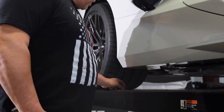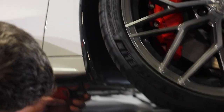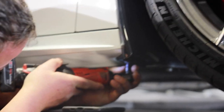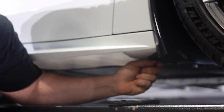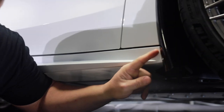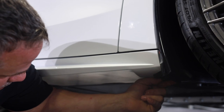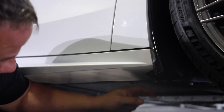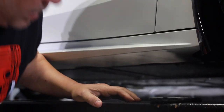As you can see, basically there are two 7mm screws in the back you're going to need to take out, and there's one 7mm screw in the front you're going to need to take out. Remember, the side skirt is going to need to go underneath your rock chip guard here, so you need to make sure you peel that back a little bit, and we're going to slide the fender flare in between it and the body.